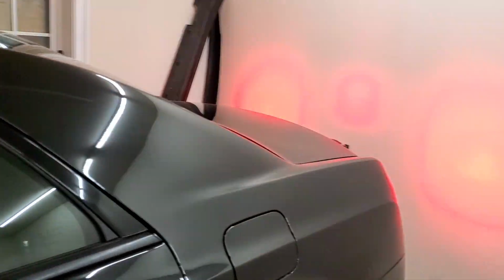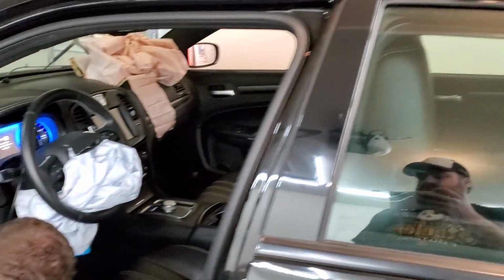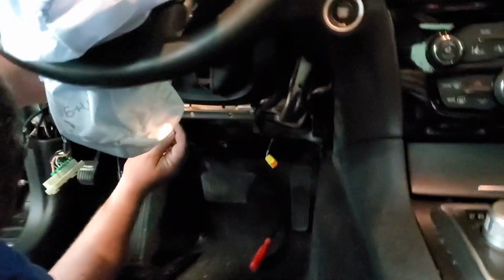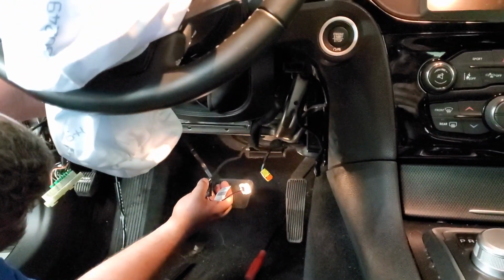We'll know when it works because the brake lights are hot. You would think. Yeah, I am game to actually rip this bottom half of this dash off. Let's do that. All right, ripping the dash out. So we were all up in here. We got the panel off from down there, the knee airbag out, and if you look behind us here, the brake lights are off. It was just the brake pedal sensor. They're still off, and so we're not sure if we need a new sensor yet, but at least we got them off so we can read the codes.